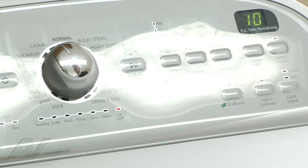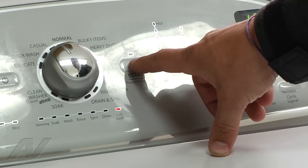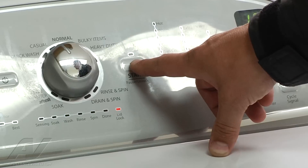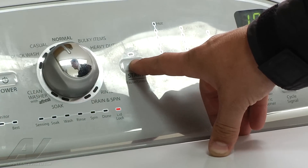So I believe for this instance maybe the unit was either overloaded or underloaded, or maybe they had some items in there that absorbed a lot of water to make it very heavy whereas some lighter items didn't have as much water to allow the machine to go off balance. So we'll just educate the customer on how this machine is different — explain the water level differences and how it washes — and just have them monitor it, because currently we can't find a problem.